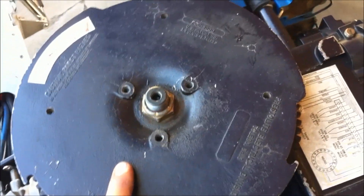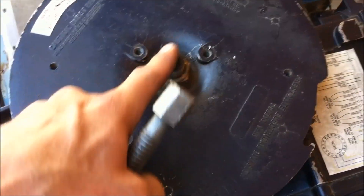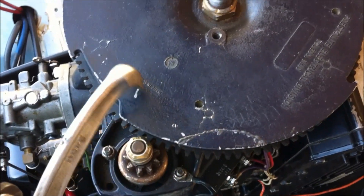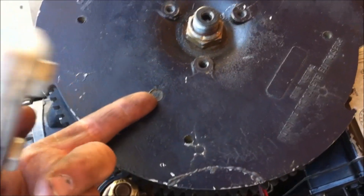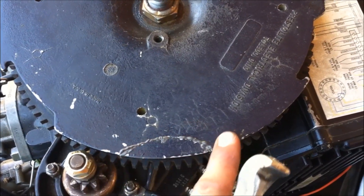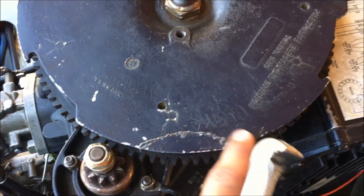I've been a bit of an idiot and insisted on putting it back on with JB weld, but this spins at such a high RPM that it needs to be perfect. It could potentially fly off, throwing the flywheel out of balance and sending it right down the crankshaft, wrecking all the bearings. I'll probably end up having to buy another flywheel. Notice they've actually drilled holes underneath the flywheel to balance it perfectly — that's why this chip is such a problem. I'm taking a real risk with the JB weld repair, I'll be honest.